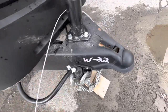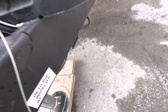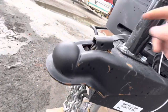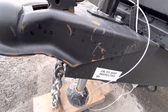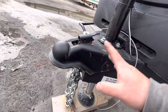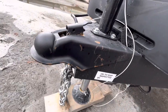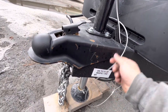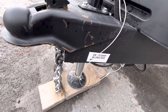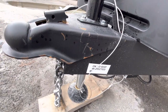This little cable is connected to a pin that goes in this box, and what this is is basically an emergency brake. We put a little carabiner on the other end of it and you'll hook it next to where your chains go. Don't hook it onto your chains, because if this ever came off and your chains failed and this was connected to your chains, your trailer would be going way behind you. Hook this next to it, and then if it ever came off, this pin would pull out and lock up the brakes on the trailer so it's not going way behind you and causing more damage.